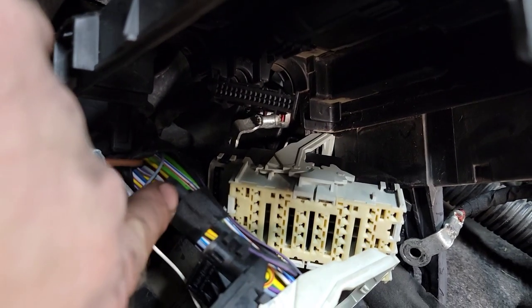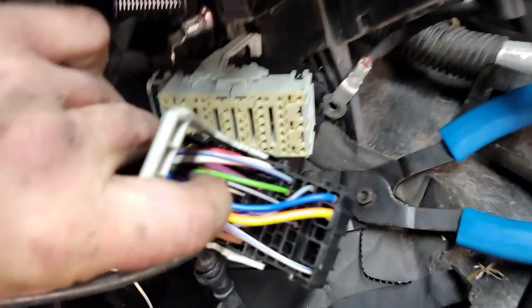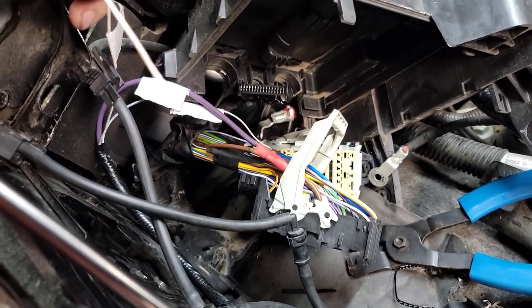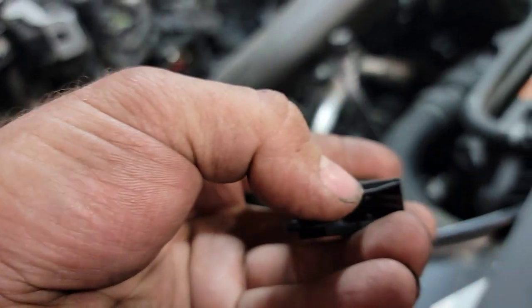This is how you deadhead that black and purple wire — just like that. I took a piece of cloth tape and taped it inside the harness. I went ahead and plugged my brown wire that I spliced in right here — it's plugged in now. And I plugged in my gray wire over here, back in the cavity where it belongs — it snapped in. Now it's time to put this back together and tape as much of this backup to factory as possible. We've got one more wire to hook up but sit tight. Now you're in this little connector here — pry open the little wings on each side with a pick and it slides right out.